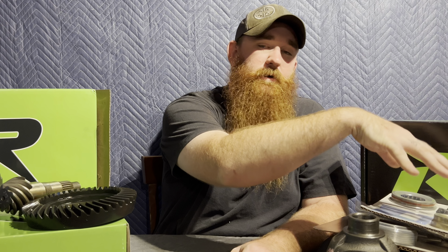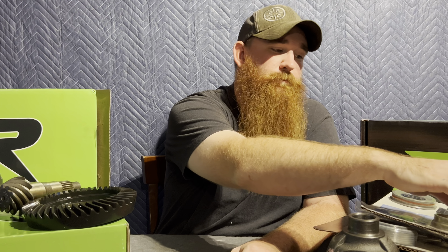I just wanted to cover some things you should do before you go ahead and re-gear. If you haven't seen my video on what gears to buy, which ones I recommend, and which to stay away from, I have that on my channel — as well as a video on the special tools you're going to need. This video is specifically about what to do before you re-gear, so I don't have to waste time in the re-gear video going over this. Spray everything down with brake cleaner — especially ring gears and the bolt holes — and mark everything for which axle it belongs to. Measure your shims and write the size on them with a black marker.